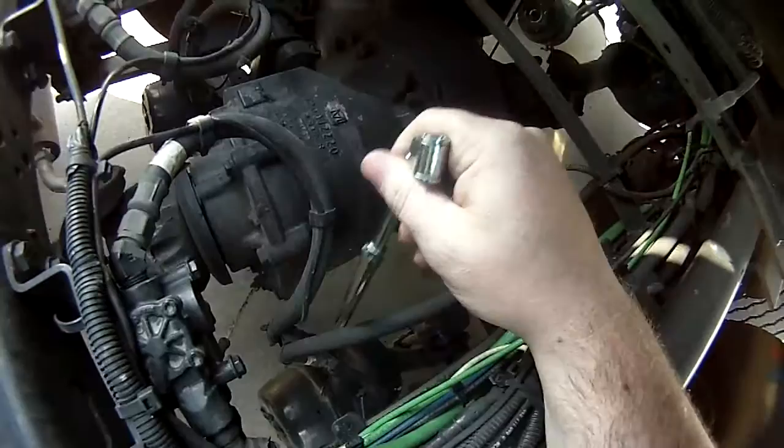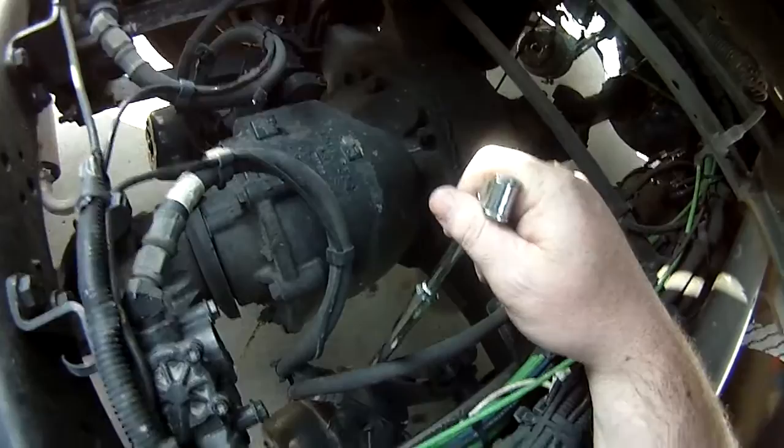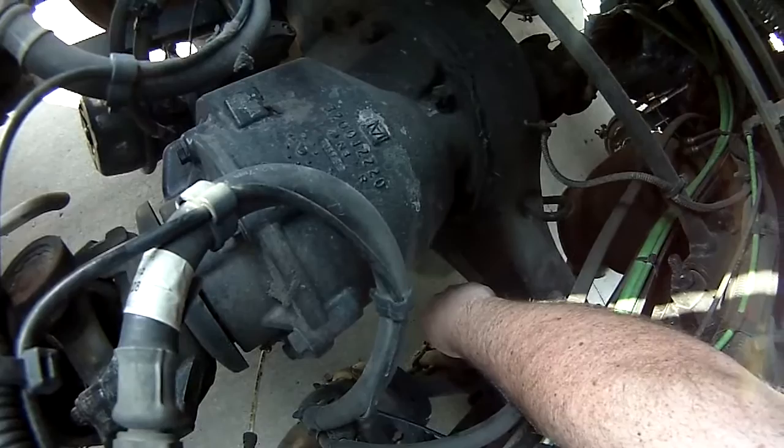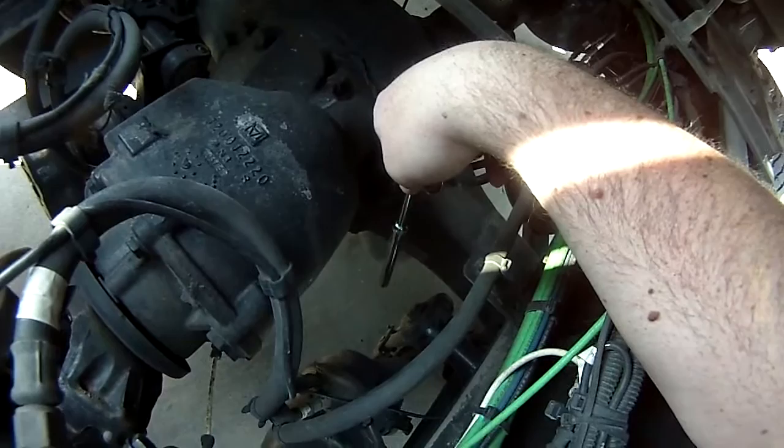Get your brake hoses, properly mounted, secured at both ends. No abrasion, bulges, or cuts, not leaking. Down to your brake chamber, properly mounted, secured, not cracked, bent, or broken, not leaking. Down here is your slack adjuster and push rod. Properly mounted, secured, not cracked, bent, or broken. With the brakes released and pulled by hand, no more than 1 inch of free play.